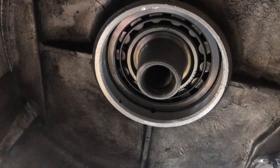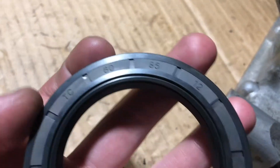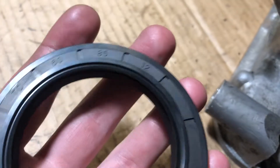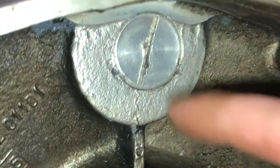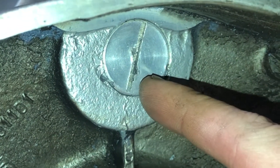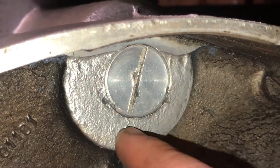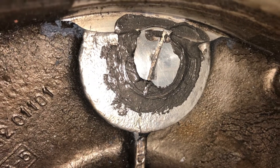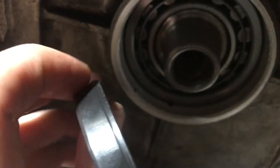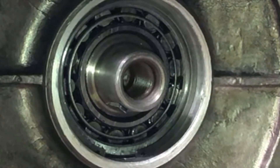Assembling the flywheel and clutch mechanism. I've got a neck oil seal — 60, 85, 12 — it has a double lip. I want to put some gasket maker around this plug since I wasn't able to unscrew it. It sits tight, but I saw some traces of oil coming from this plug. Before installation I should put some oil on it, and also some oil inside this rear bearing. Installed a snap ring.